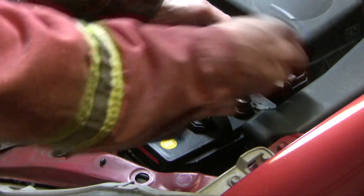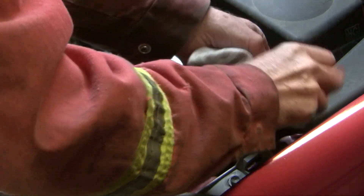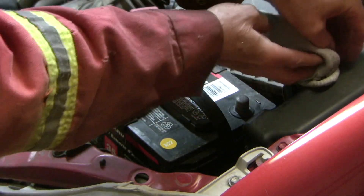Because we're removing the alternator, the negative connection on the battery needs to be removed. I put a sock on the free end so even if it springs loose, it can't make contact with the battery.